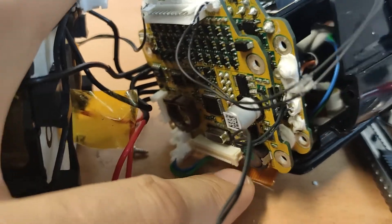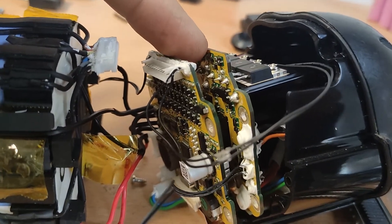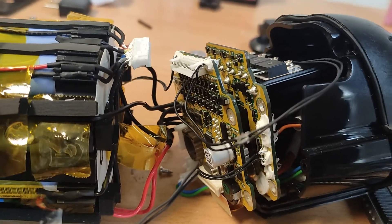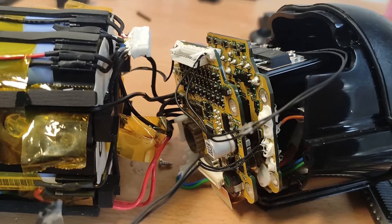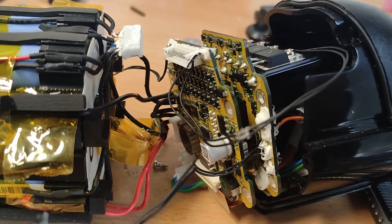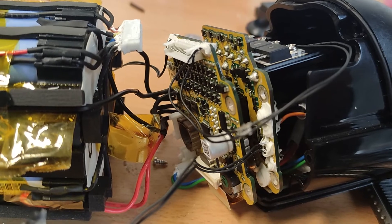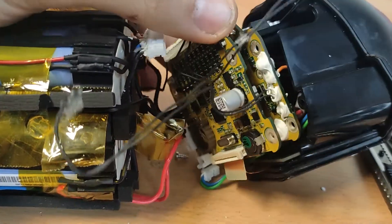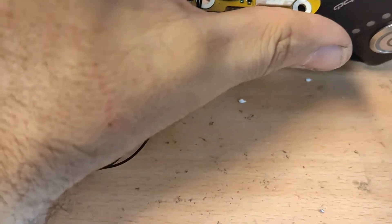Here is a detail — this is for powering the turbo button and I had to pull this out to disconnect it. The idea is to replace this electronic unit with a regular aftermarket BMS. Because of the sensors and everything connected to the Specialized bike, I will replace the controlling unit with a Go Swiss Drive, which can overwrite the regular controller.